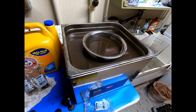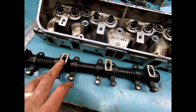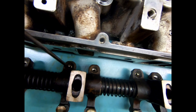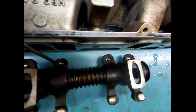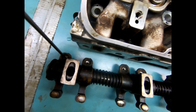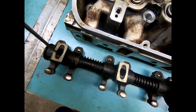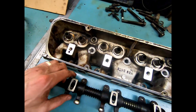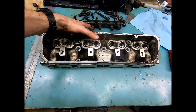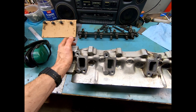Recap for the day: this does not look much cleaner but I did actually blow some carb cleaner through it. Some of these were actually packed up — I got them cleared out, but that's not to say they don't still have a bunch of schmutz packed in, or that I didn't just shove it from this chamber down somewhere else blocking passages. These are really dirty. The whole thing really should get cleaned, but I got it cleaner. That actually does look much better.